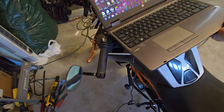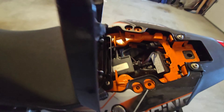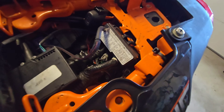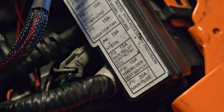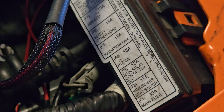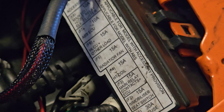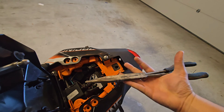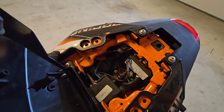What you're going to do is normally you would undo your battery to facilitate that, but in our particular case I don't want to take all this apart. There's an easier way to do it. If you look on here, there are a couple of fuses — we have main fuse, main relay for ECU (that's the 15-amp one), and main ECU 10-amp. Those are the three fuses I'm going to pull. You might want to use some needle-nose pliers — I like to use these. They're really hard to get to because they're tiny fuses. I'm going to go ahead and do that now.